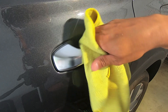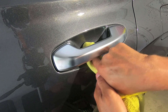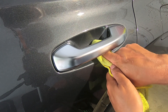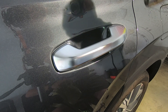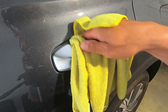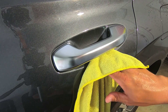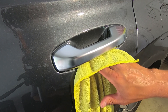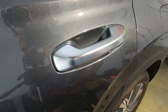Keep slowly working the fluid out. Once the film is on and most of the fluid is removed, have your microfiber ready and hit it with a little bit of heat. You don't need a ton — just enough to evaporate the last remaining fluid and work out any small bubbles. Plastic, metal, and paint is a bad combination with excessive heat, so just a quick pass. The heat also helps the film conform to the surface. Any remaining air bubbles will typically evaporate or work their way out over time.